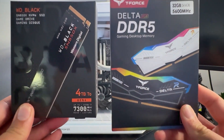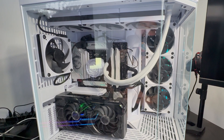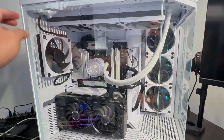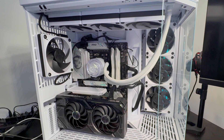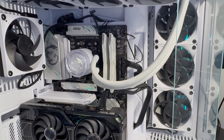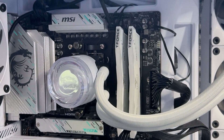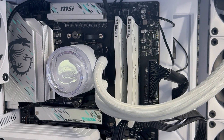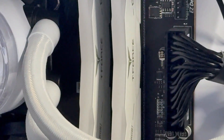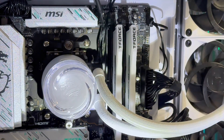For my tech heads — I'm going to input these two things into my computer to make it go a little bit faster since I do a lot of work and need a lot more memory. We're basically just going to be installing 32 more gigs of RAM and an SSD drive. First, you must pop off the front glass — you just take the top left-hand corner and pop it back and it comes straight off. Your front faceplate may come off differently, so please read the instructions for your specific build. As we zoom in, we're going to see where we input our RAM — between the two sticks we already have — and then our SSD card, which is actually behind my graphics card. Be sure you locate your SSD slots, as some computers only have one, others have two.